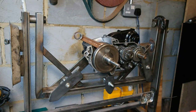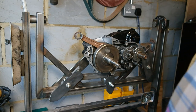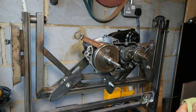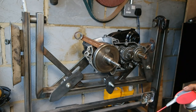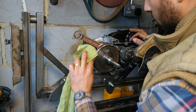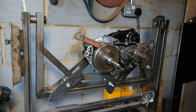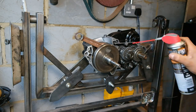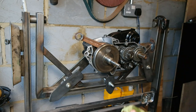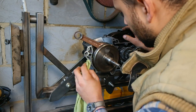Now that we're at this point, we're ready to stick on our sealant - I'm just going to degrease that edge. By the way, I don't think you can actually buy a gasket for this, just in case anyone's wondering why I'm using a sealant. I don't think they came with a center gasket, but even if they did - if you were to stick a gasket in there, no matter how thin it is, you are spreading the cases apart. This transmission is designed - its tolerances are designed for gasket sealer rather than an actual paper gasket. So even if you do manage to find one, if it wasn't on there originally, I wouldn't put it on.